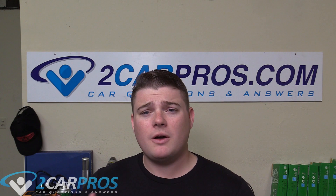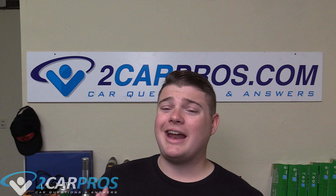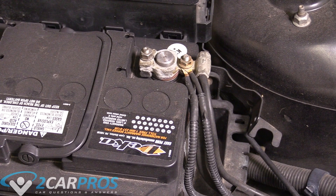With Thanksgiving right around the corner I wanted to make a quick video about something that can cause a lot of problems. If there's a lot of coking developing on a throttle plate, that could throw all kinds of interesting error codes that you wouldn't really think are associated with it, but they are. This is an easy way to service your throttle body, and even if it's not throwing any codes, it's just good maintenance. As you'll see later in the video, the one in this car is absolutely filthy — one side looked white and the other a bronze-ish color, but it was just that much coking on the back of the throttle plate.